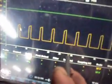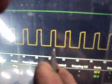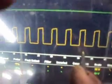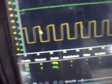We'll turn the AC off — we had the AC running there — and we'll see if our duty cycle changes. We were running at about 90% before. Now that we turned the AC off, the duty cycle of the cooling fan is actually decreasing. We were running at 90%; right now we're getting close to 50%, and the PCM is slowly backing off the cooling fan. However, our fan motor is not running.